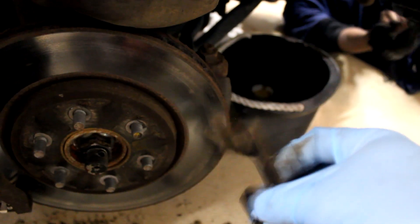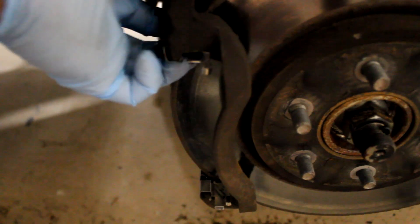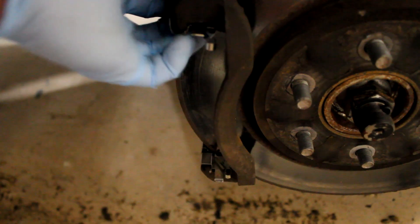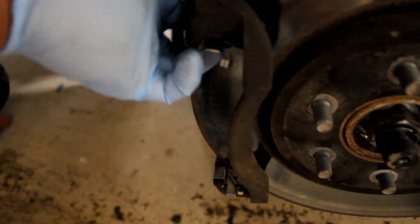The Xterra's brakes are two-piston calipers, which is pretty cool. I ended up taking these old crusty brackets off and put some new shiny ones on. You just snap these on in place, and once those are snapped in you can go ahead and stick your pads in there. This one I might have to hold because it's not snapping like it's supposed to, so I'm gonna have to put the camera on the tripod.